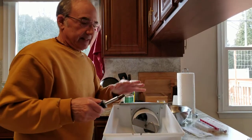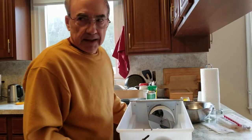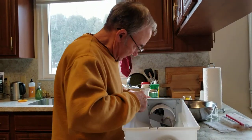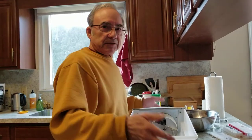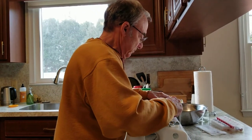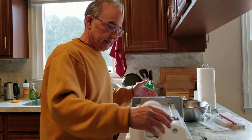Before I did this I was online thinking I was going to have to replace this whole unit, which with shipping would have cost about two hundred dollars. My refrigerator is already eight years old — is it worth spending two hundred dollars replacing this? I said wait a second, before I get another one, why don't I take it apart and see if I can figure out what's wrong and fix it — what have I got to lose? So if the same thing happens to you and your blades get bent, you don't have to call a repairman. Just unbend the blade so it can rotate.